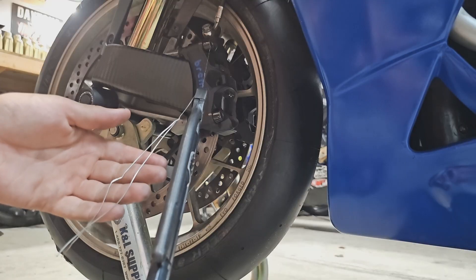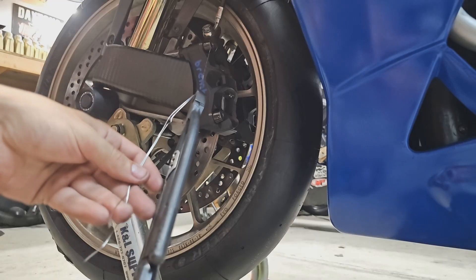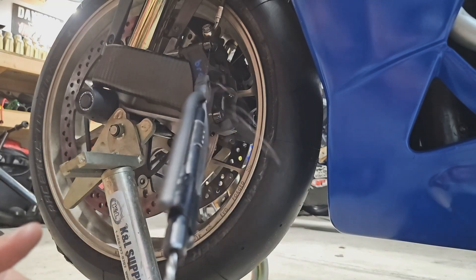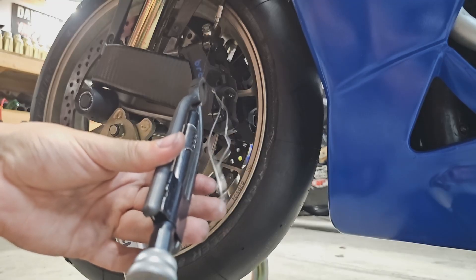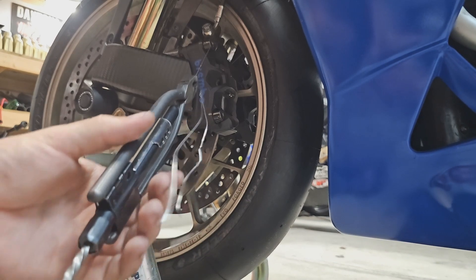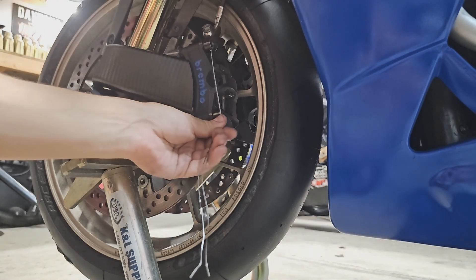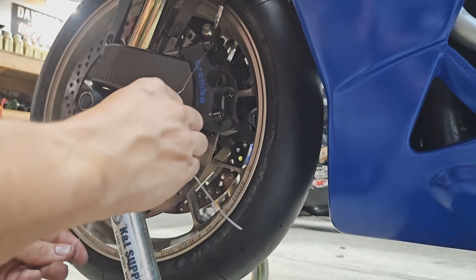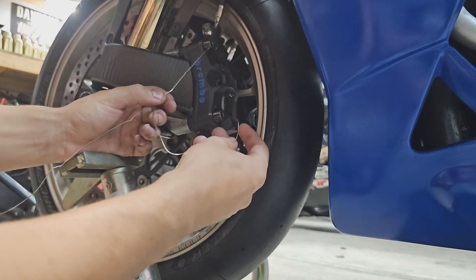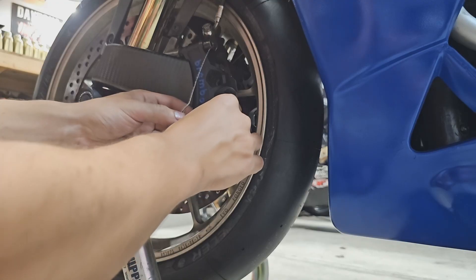So when you're twisting, if you have a lot you'll get this like big old tail. And if you had the bend, it'll scratch up all your stuff. So you can actually move that down on your pliers just right next to them, and then it'll stay down there. You're going to twist, pull that thing all the way out, and then release it at the end — it should spring back in. In other venues in the world that are not racing motorcycles, there are requirements for how many twists per inch you have to have, but just know that you can't overdo it. And if you do overdo it, you'll just snap it and then you'll have to restart. It can be extremely frustrating.